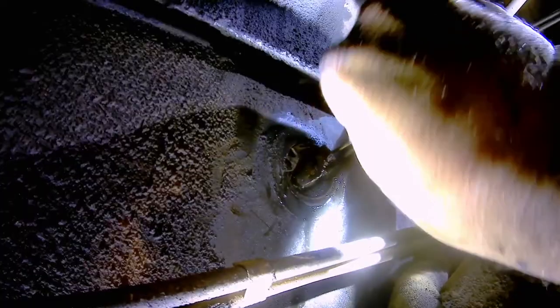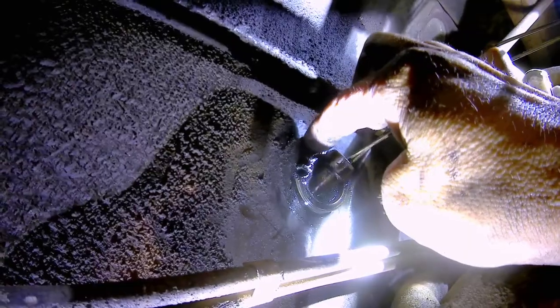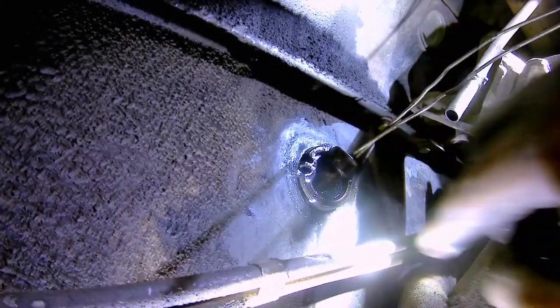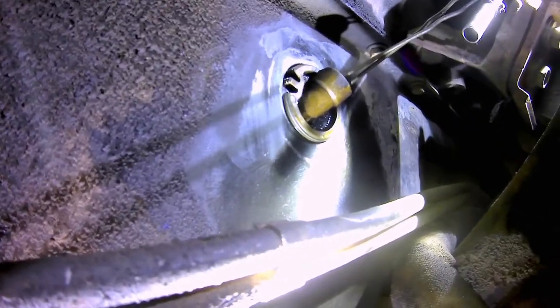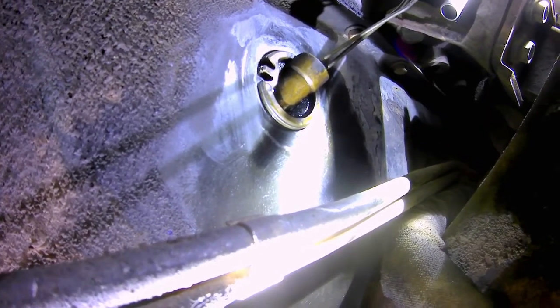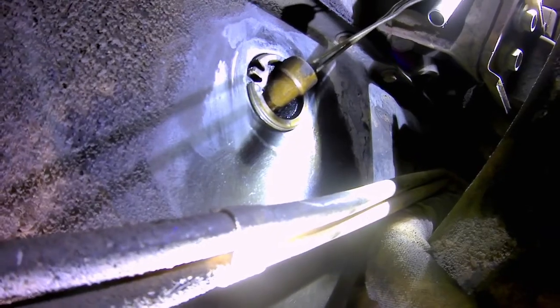The reason this unit fails is because that o-ring gets oil on it, it swells up, and it pushes out the sealing surface in the back. The o-ring will no longer be used behind this unit. Now we need to clean up the oil pan and the adapter — wipe it down really good and get all the dirt and grease off. I've cleaned the oil pan all around where the adapter goes through to the outside. Some guys like to spray brake clean here, but I am not a fan of spraying brake clean where it can go inside the engine oil. Instead, I saturate a rag with brake clean and wipe the whole surface down to prepare it for the installation of the repair.